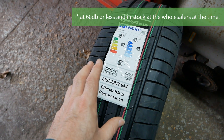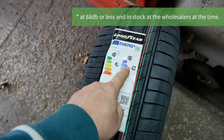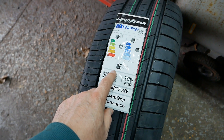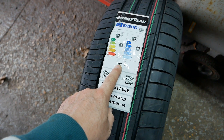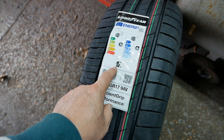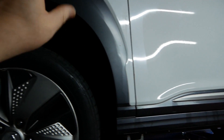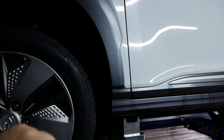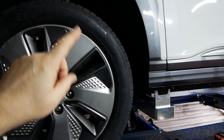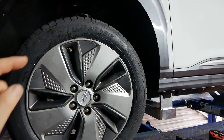When it comes to buying tyres for an electric vehicle, you've got to bear in mind efficiency and wet grip ratings, but in this case I thought it was more important to look at the decibel rating — the noise value — because this is three decibels less, and apparently three decibels is half the noise. On an EV you've got no engine so they're very quiet, and all you can hear is the tyre noise. Going from a 71 decibel tyre to a 68 decibel tyre should make quite a considerable difference.